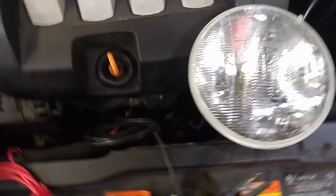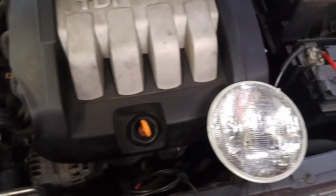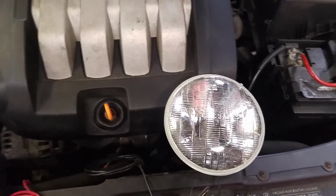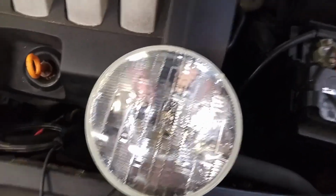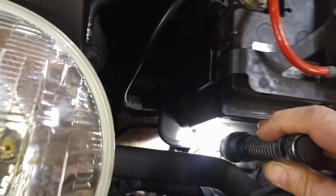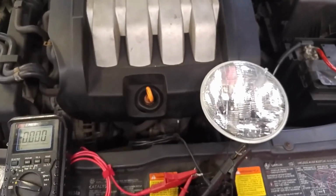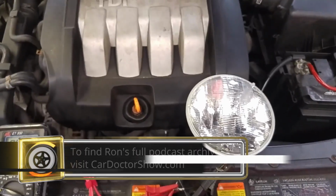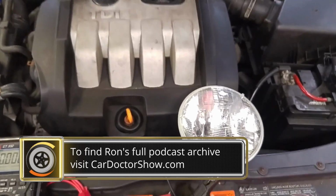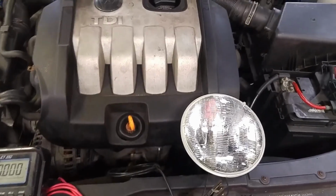So a real simple test. It's looking for 4 ohms of resistance on this particular car across the AC compressor clutch to actually know that it's safe to turn on and apply voltage. What happens is the fan controller, which sits down here under the battery, is a module. It's looking at the resistance value of the compressor clutch to know whether or not it's safe to just try and turn the compressor on. It sends out a signal. It looks for a correct voltage drop response.